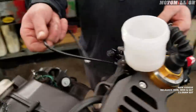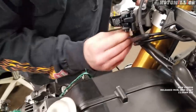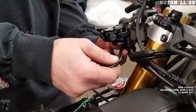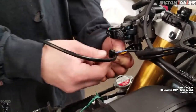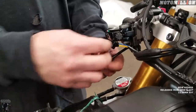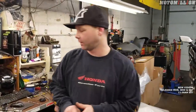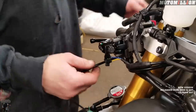It comes with its own brake light switch. We're probably not going to address it today just because these handlebars aren't staying in this location, so we don't know how much wire we'll need. We're going to cut these wires — actually what I'll probably do is put spade connectors on this and then we'll clip it in. That way if you do want to take it off you could. If you were soldered, that'd be a pain. We'll just use two spade connectors connected to the factory wiring and that'll make our brake light work again.